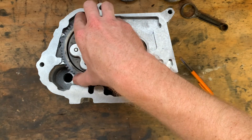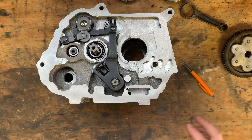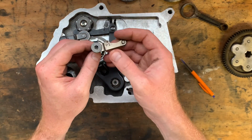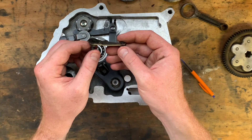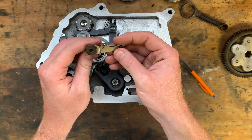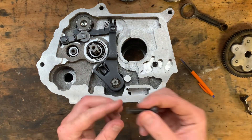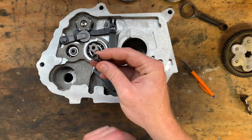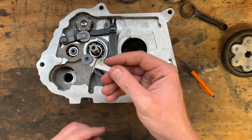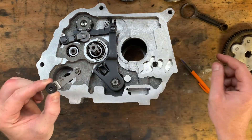The input shaft rubs on that screw. Obviously there's a factory solution which is this nice flat screw here. I think I'm going to try and emulate something like this — maybe a cap head, we'll see. I can't use the factory one for obvious reasons; different lengths and the head is a different diameter.